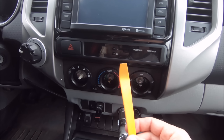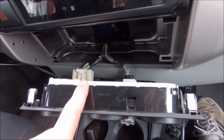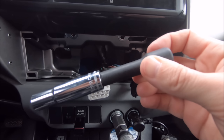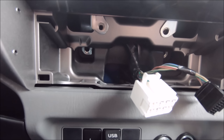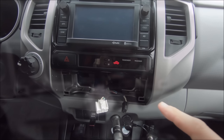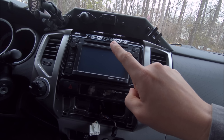Don't pull it too far because there are two electrical connections you have to disconnect in the back. With the faceplate for the AC panel controls hanging out, go ahead and disconnect both of the electrical connections. For the next step — I didn't realize the GoPro was not recording — but you will take a 10mm socket, preferably a longer one with about a three-inch extension. There are four bolts to remove: one in the back right there, another one right back there, and then two in the top. Go ahead and remove all four of those bolts.